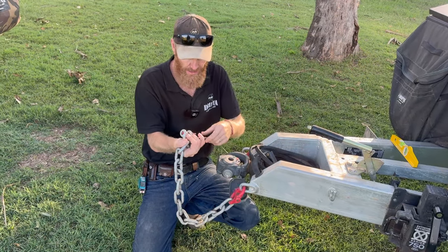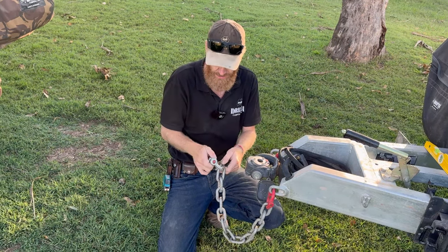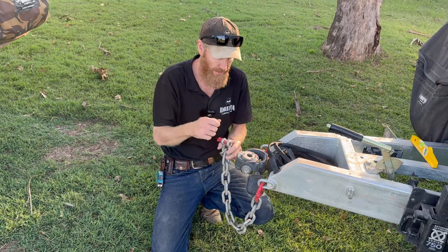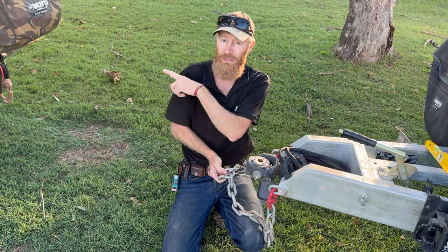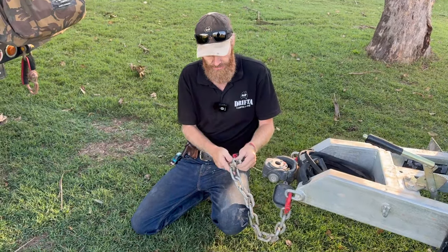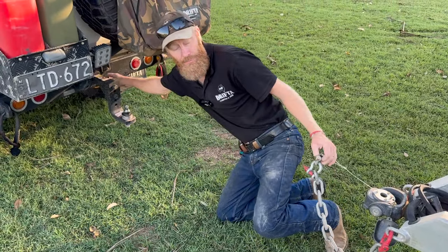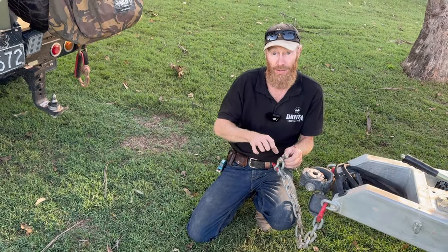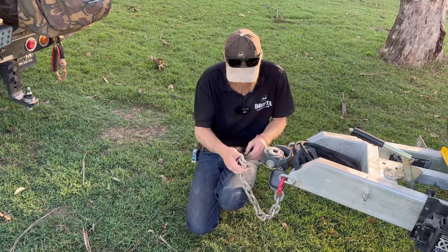So very important that this little cable is attached, and you can use a small D-shackle to attach it, and that's how that works. So if that breaks, that's going to pull out. This should be attached to the vehicle separately, okay? So how that was there is a little bit not quite right. That should be attached to the vehicle with a separate D-shackle, okay? So if the vehicle separates, that pulls out. That's the idea of that.